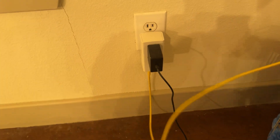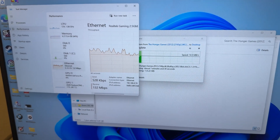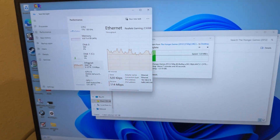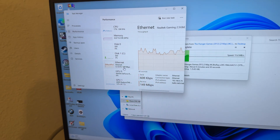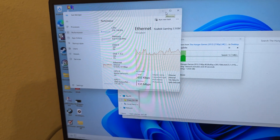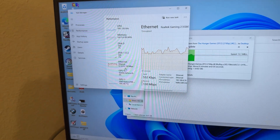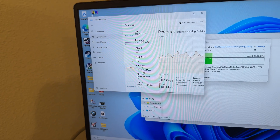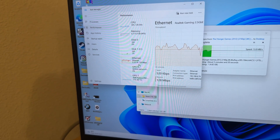I have it hooked up now — here's the power line adapter going into the laptop. As you can see, it is moving data. It's not super fast — moving a Linux ISO, you can see it's moving at about 128 to 150 megabits. So it's not super fast, but it is going to be consistent. You're going to see this all the time. It could be better than WiFi if your WiFi isn't that great, but chances are if you have decent WiFi, this is going to be slower. Really the main thing is that this is consistent. This is plenty to game on — your downloads are probably going to be a little slow, but at least for gaming it's going to be consistent. Your ping times are going to be good.